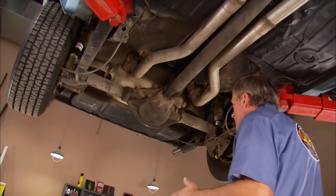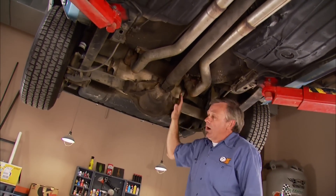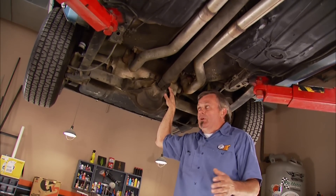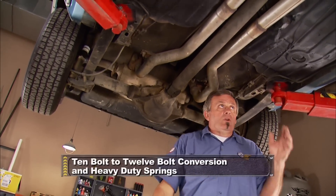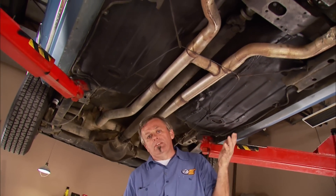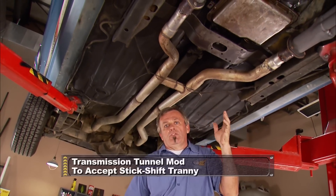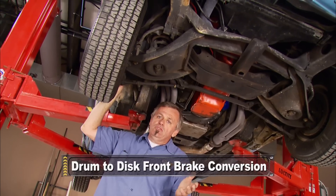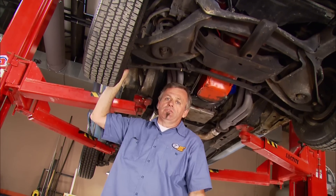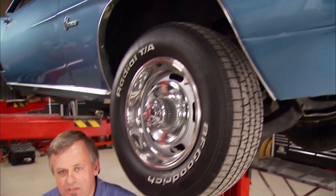One major area left is the 10-bolt rear axle — plenty strong enough for the 307 we're taking out, but nowhere near strong enough for the 427. We're going to replace it with a GM 12-bolt and multi-leaf suspension system. We'll make any necessary sheet metal repairs, and we are going to have to change the tunnel to accommodate the 4-speed Muncie we're putting in when we get rid of the automatic. Then we'll get rid of the old drum brakes and use stock-style OEM GM discs — not a massive upgrade, but staying with the OEM theme, it's definitely going to help stop that big motor.